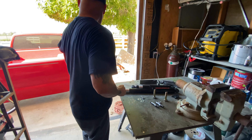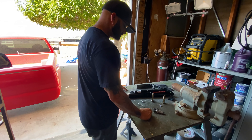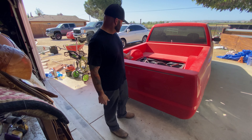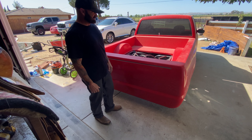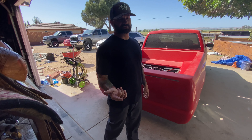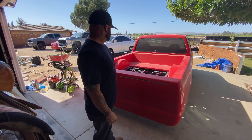What I'm going to do right now is get the tops all mounted on, then get the bottoms marked up. I'm just going to weld these studs on the links. As you guys know, you can run your airbag truck without shocks, but this is what you end up with - it's pretty bouncy and not a great ride. With a 3/8 line it's not very fast either. That's why we're going with shocks. You could ride lower and tuck more because it's more stable and you don't have to worry about bouncing.